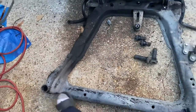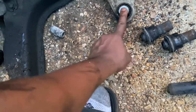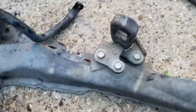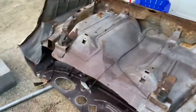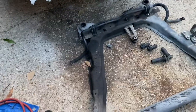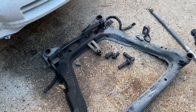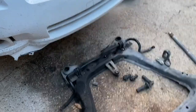Next I'm going to just put my new bushings up in the front and back. I'll probably replace this here — I think this is a transmission mount too, while I'm at it. Get a new mount, get a new one of these here, and we ought to be ready to put it back on. I didn't drop the motor — the motor is still in the car. I just dropped that K-frame. We're still working on this. But that's how you do it — it wasn't easy at all. All that clunking, we're going to avoid that. We're going to get it right. I'll let y'all know once we get it back on the car and see how everything rolls.